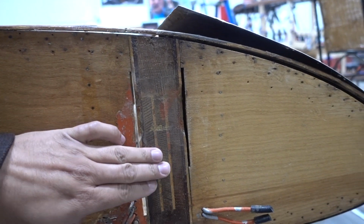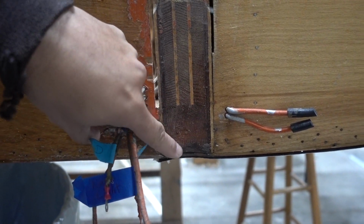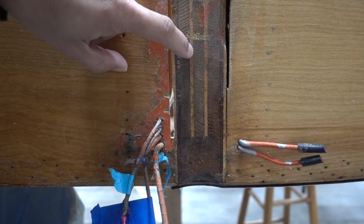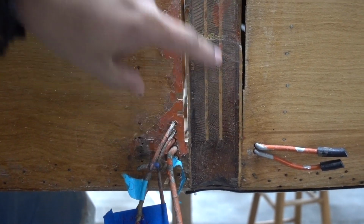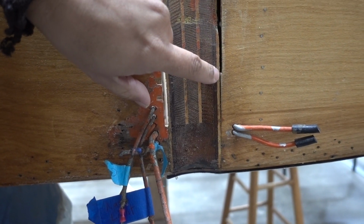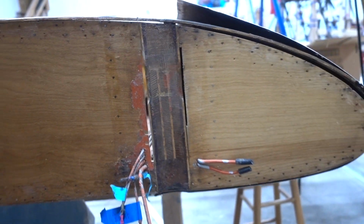Look at this big spar here. Look how huge that thing is. And it's an I-beam, if you look here. So here's a piece of wood here. Looks like it's a laminated spar here between two, looks like maybe two pieces of plywood. And then there's a piece up here, so it's an I-beam. And then there's spruce on the side of that. And then it's sandwiched with gussets. These outer marks are gussets. This is a bridge. You could walk across it, drive across it with a tank, and it won't fail.